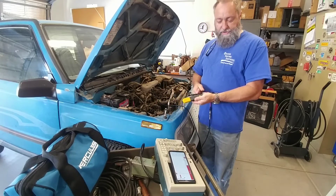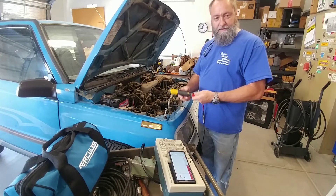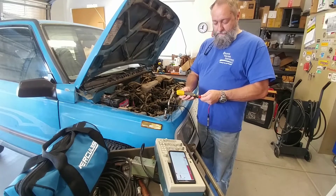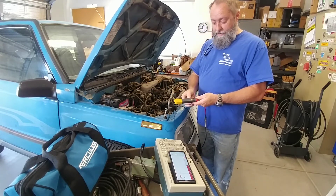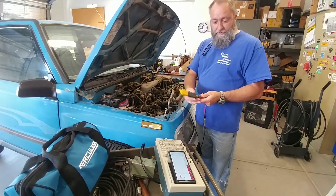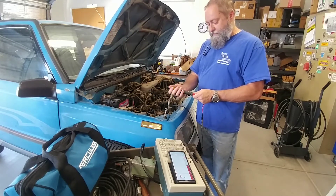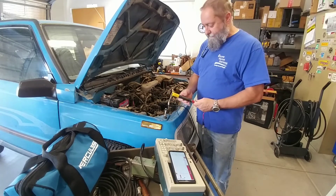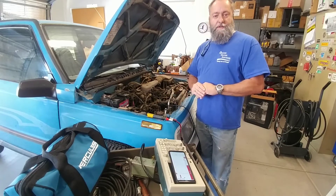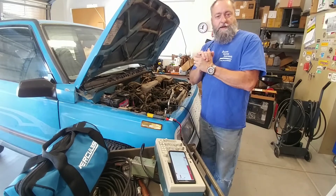Pocket Pro will work for secondary ignition. That was the one I was most curious about, just because of how the inductive pickup works — it's either a thousand-to-one or ten-thousand-to-one ratio attenuator, so I wasn't sure if that was going to be a problem. But it does get a reading. Hope to do some more tests — pretty exciting, that'll be pretty fun. Thanks for watching; if you find it useful please like and subscribe, and any comments or tests you'd like me to do, put them in the comments below.